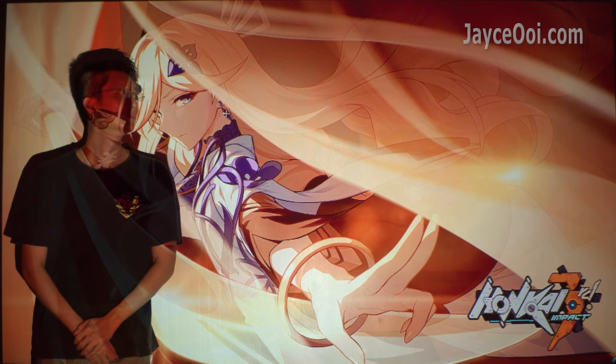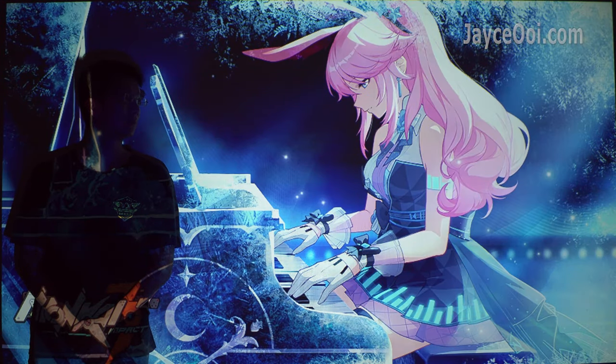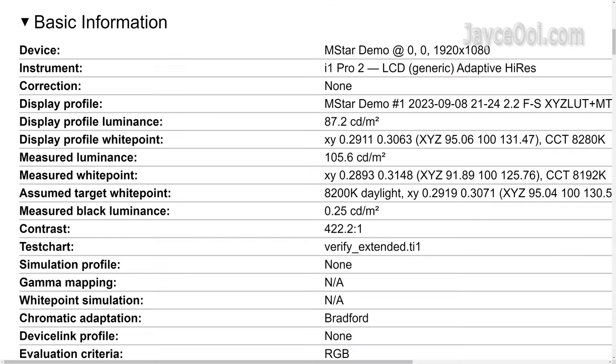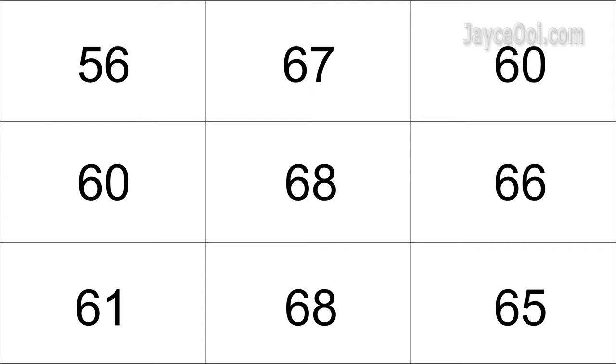Keep the screen as small as possible for the best experience. The projector achieves perfect white level thanks to colour temperature adjustment, almost perfect sRGB and excellent BT.709 gamut coverage, over 400:1 contrast ratio, and excellent brightness uniformity at 82%.